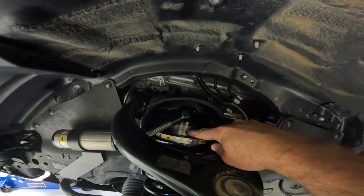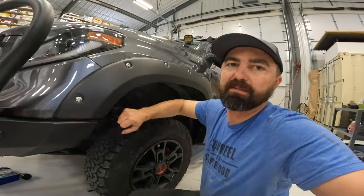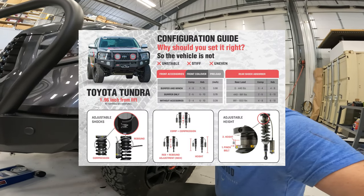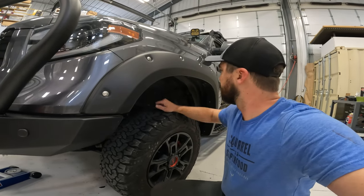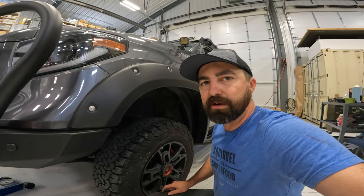In the manual, there are instructions that say if you have a front bumper — which I have — and a winch — which I have — to adjust the preload to 25 millimeters so that you have three inches of height when you're done. And it appears that I got every bit of that. I'm pumped on the front. Now the rear.